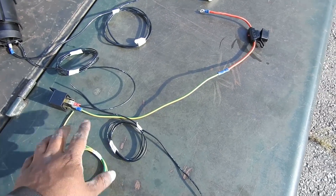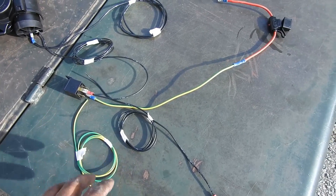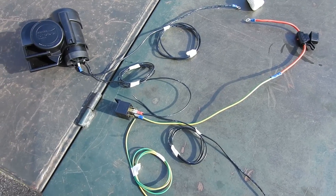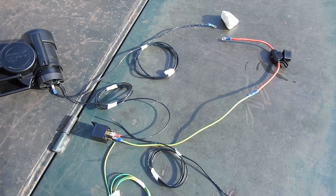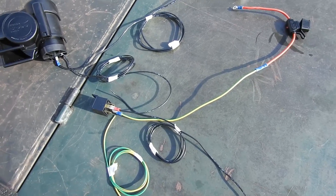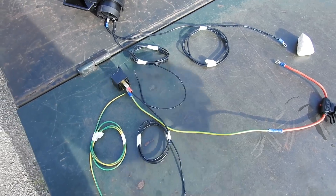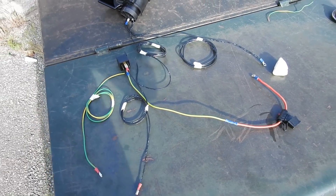I hope you're able to understand things. Unfortunately I didn't have different colored wires, so I had to use the same color in different sizes to represent stuff, but I hope you get the idea. That's basically what you need to wire your horn. I'm going to do another video for installing the wiring, but this video is just strictly for creating the wiring kit. You can either spend 50 bucks for the wiring kit, or spend about 10 bucks and get the supplies and do it yourself. Just remember to have a 20 amp fuse in there and your 14 gauge wire for the battery. The other wires can be the smaller stuff — 18 to 20 or 22 gauge.